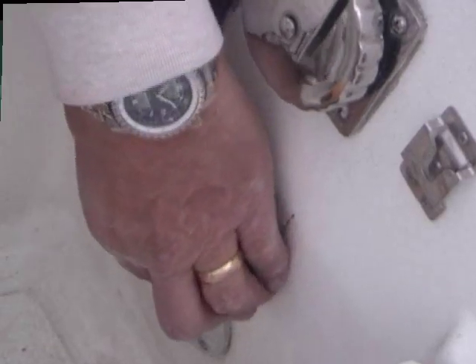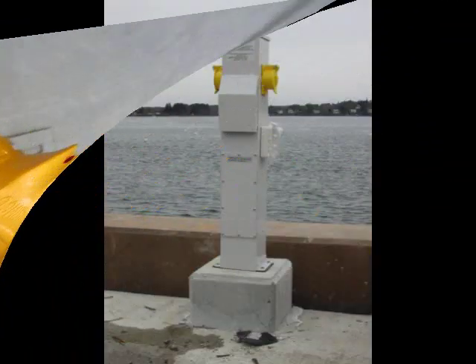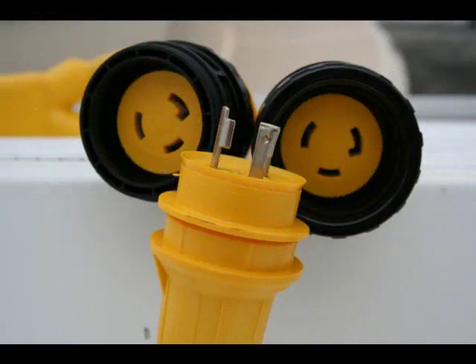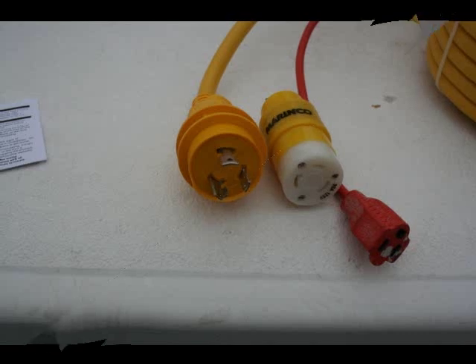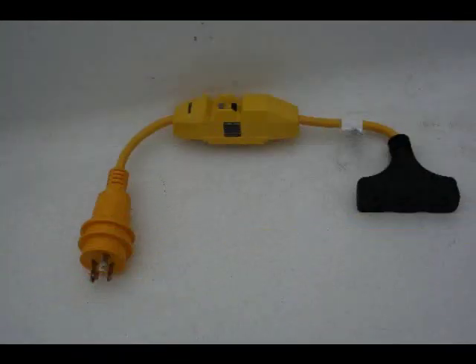As I mentioned, I picked up a couple other things. Here's the 50-foot cable — I picked up the one that's got the safety light on it, which lets you know that you have proper power to plug into the pedestal. Also, if you're cruising around, this Y adapter is really nice to have — you can plug in both of your 30 amp cords and that'll plug into a single 50 amp at the pedestal. There's also this little piece for shore power that lets you attach a regular extension cord and plug right into the boat while on land. On the shore power side, I also picked up an adapter with a built-in ground fault — a really handy device when you're doing work on the docks and need to run a 110 cord without running it from the boat.